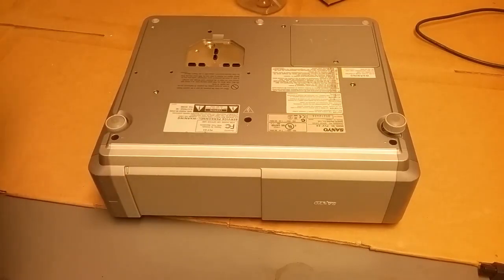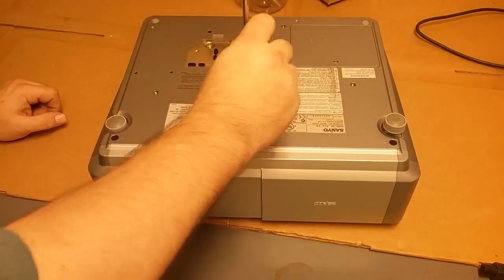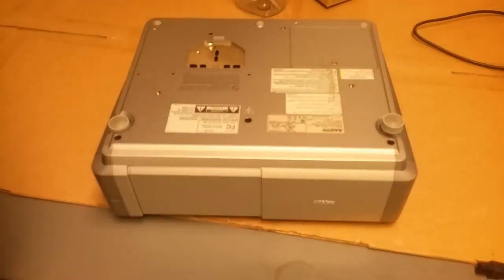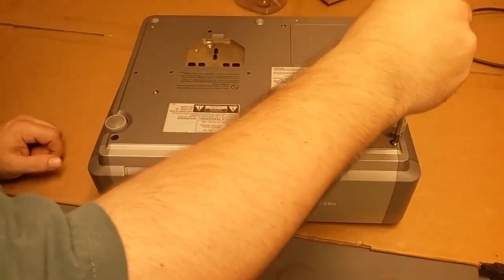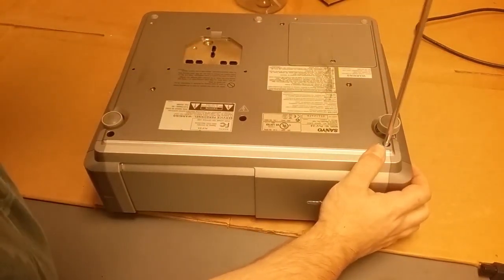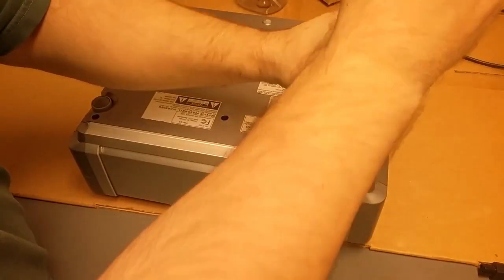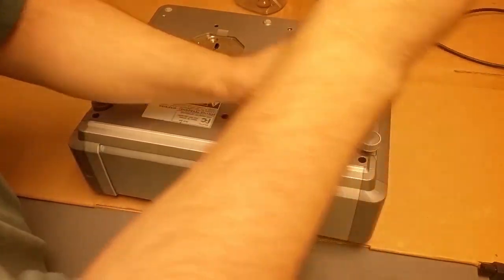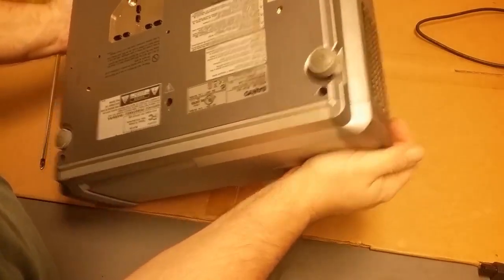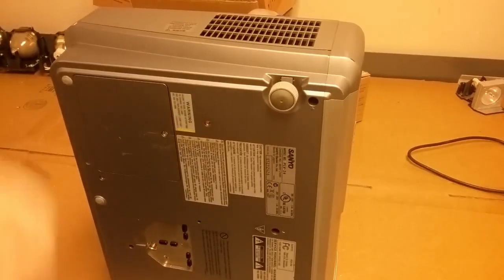It's the green panel. There's the blue panel, there's the red panel, and the panels don't actually set the color. The panels have the colored light fed into them. Then they go into this cube, and the cube is actually four triangles of glass, as you can see in the top there, and they bond them together. And if you look on the front, this is kind of dirty. So I'm thinking a good cleaning is going to take care of all of this. I want to get those other screws out.